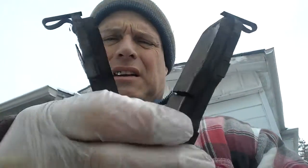Coffee time. One thing with these brakes is there's still plenty of brake pad on them. But the rotors are rusted. When the rotors rust, they wear down the brake pads a lot quicker than they normally would. So it is best to change them. It would probably pass a safety, but I'd rather have brand new brakes and know what I'm up against instead of having a brake failure someday. I've had that before where all of a sudden there's a big bang and you don't have any brakes. That's not fun. Especially when you're trying to stop.